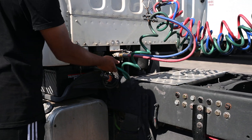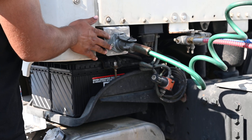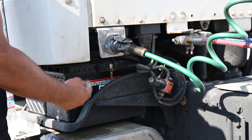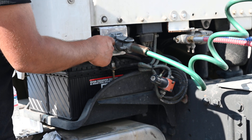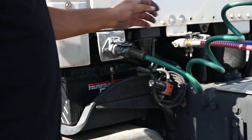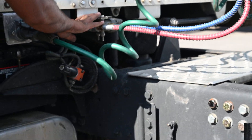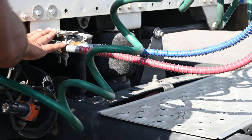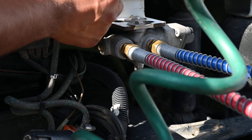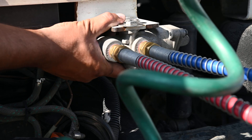My electric line on the tractor side is properly mounted to the tractor connector. The tractor connector is not cracked, damaged, or broken — there's no nuts or bolts missing, no pins missing inside, and the safety latch is always on. My airlines are properly mounted to the tractor connector; the airline tractor connector is not cracked, damaged, or broken — there's no nuts or bolts missing, no seal missing, no leaks, and it's properly mounted and secure.